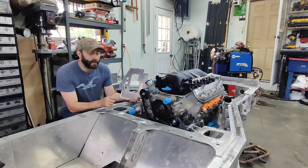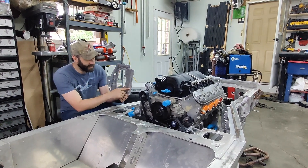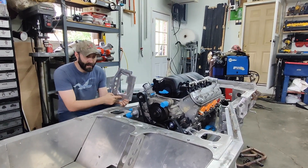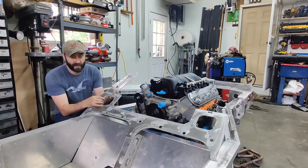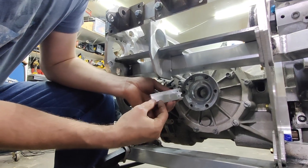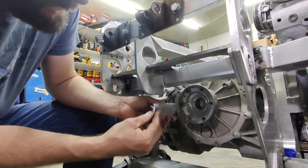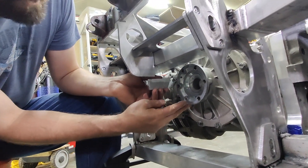Modifications to the chassis included removing these side plates, which are used to mount the engine. We're going to redesign them as an L, and also removing this plate in order to get these taken out, where these will also be cut straight here and here. The other modification to the chassis was removing this wiring loom tab, which was welded straight onto this piece but interferes with the axle flange.